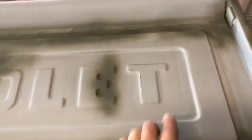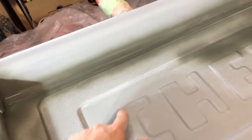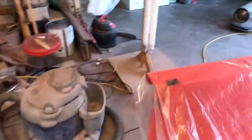And if so, then I'll paint these letters white, let it set up overnight, and then come in and, like I said, put the stickers over top of the letters to preserve the white, so that I can spray the whole thing the base color of red. Then I'll carefully pull those stickers off, wipe them with some prep clean, and clear coat the whole thing. At the same time, I'm going to deal with these steps that I have to do a little more wet sanding on. Once those two things are done, all that's left is to flow coat the rear fenders.